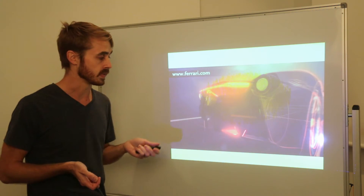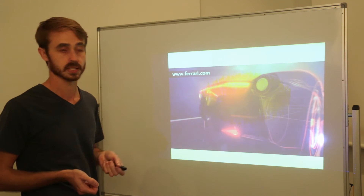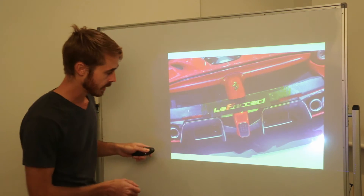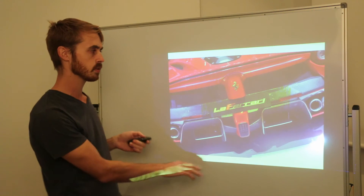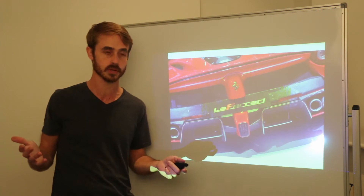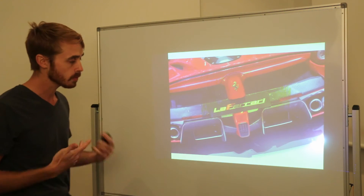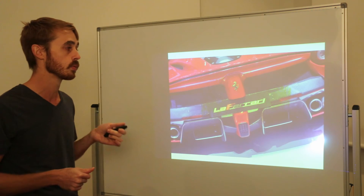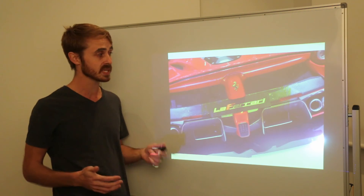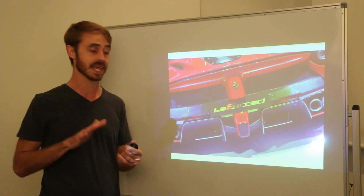Moving to the rear, the video highlights these rear diffuser flaps and the rear wing. These diffuser flaps go up and down in conjunction with the wing to change the downforce. In real life they're basically two panels that block off half the diffuser channel but not the whole thing. The diffuser is inherently a drag reduction device — it fills in the wake behind the car, improving efficiency by reducing the low pressure region. Blocking it off seems counterintuitive, but I think what's happening is that as the rear wing retracts, the fairly steep diffuser angle probably can't be supported without the wing, so it separates. By dropping these flaps down they can probably keep the flow attached and avoid losses there.